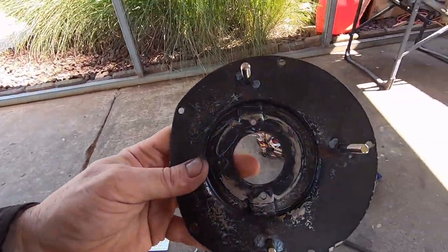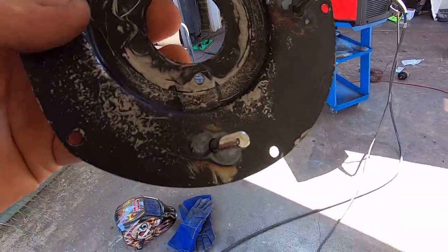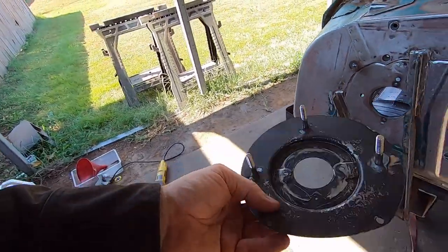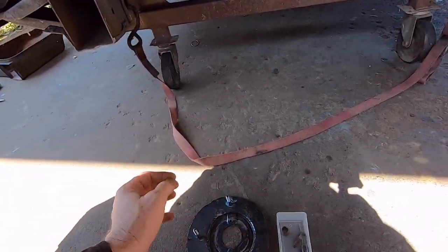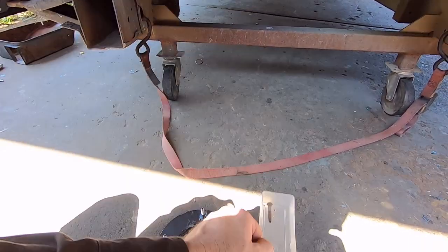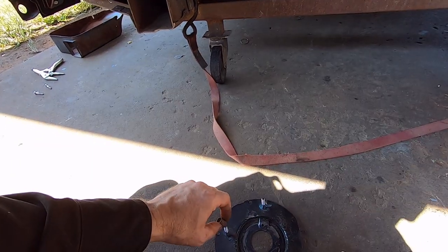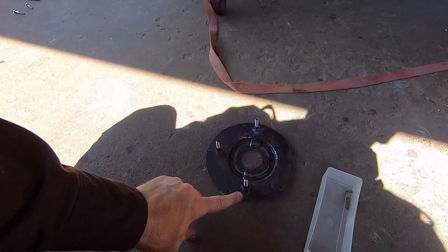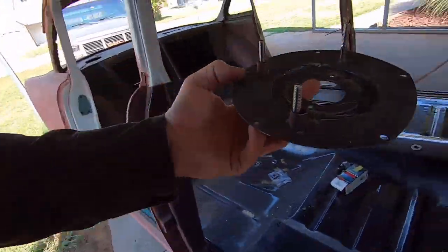I replaced the studs with stainless steel and you can see the ends of the bolts - how much cleaner they look after doing the work. The blower motor bolts to this and it will actually go through the firewall. Originally these cars come with spacers - you should have five total, three for the blower motor housing and two for the main box. You put the sleeves on first and then put it in.